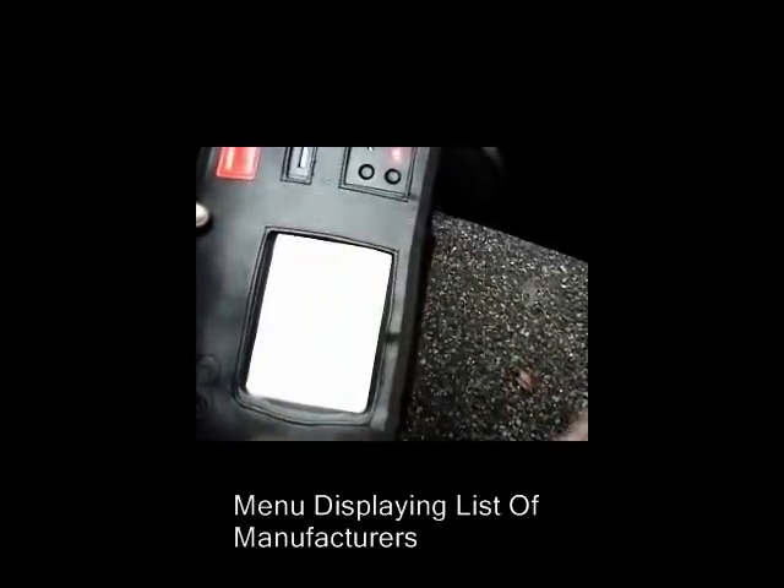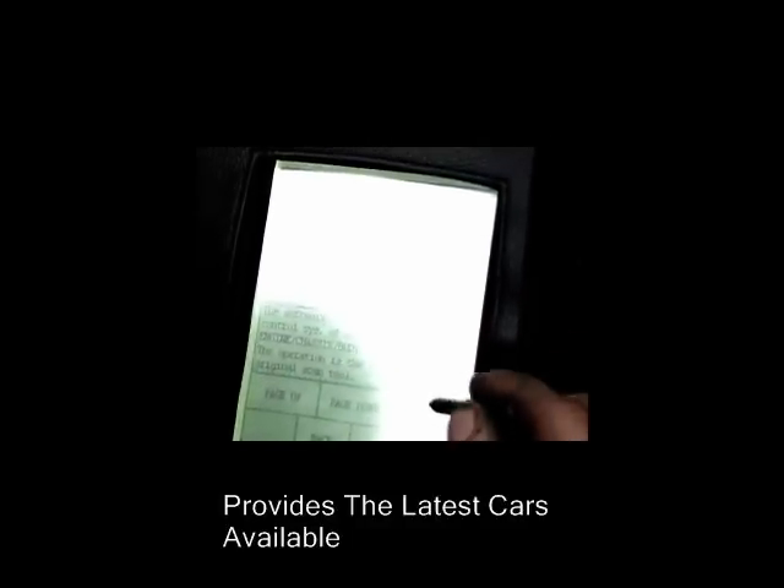We're going to go via BMW since this is a BMW car. This is version 35, the latest version. This software can diagnose the electrics and control systems of BMWs up to 2006, including engine, chassis, body, and other parts. The operation is the same as the original scan tool. It's now resetting the smart box and adapting to the BMW — basically loading all the BMW software.